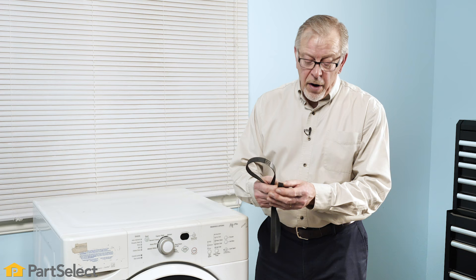If you're getting a squeaking sound from your washer and your washer uses a drive belt, that might be the problem. First check that the inner basket turns freely, to verify you don't have something caught between the two tubs. If that's not the case, check the belt — verify that it's not dried out, cracked, or loose and slipping on the pulley, and if so, you'll need to replace it.